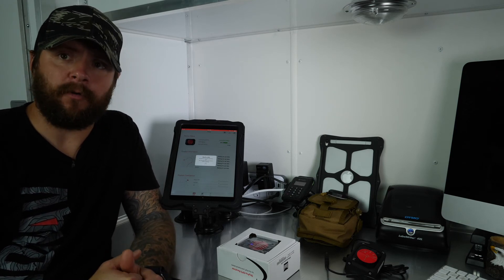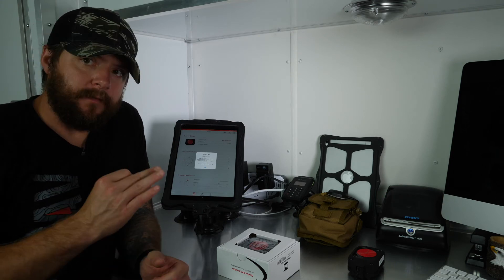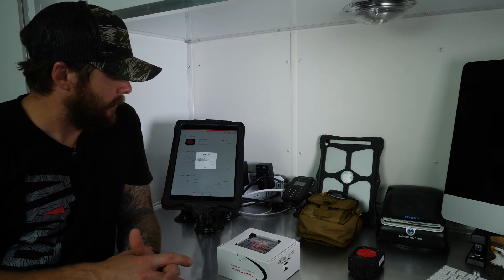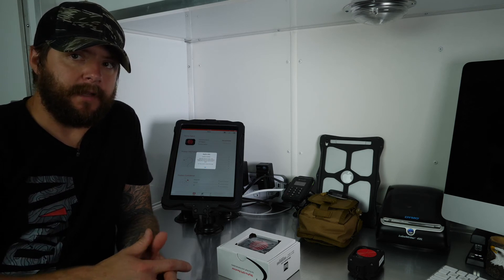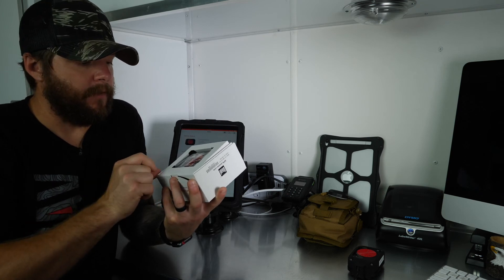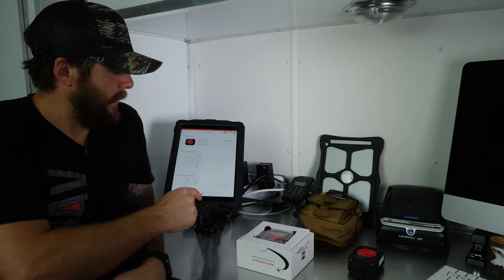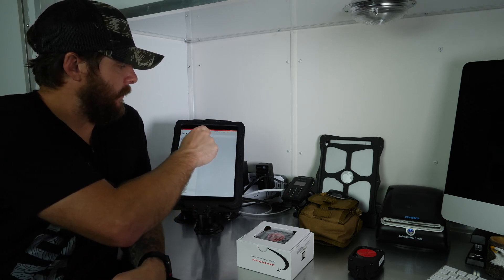The update is wrapping up at 75%. After the update you get a pop-up: 'Update complete — XGPS 160 will disconnect. After forgetting the device in the Bluetooth paired list on the iOS device, pair it again. You may need to reboot this app.' The puck did a firmware update reboot. I'm going to power it back up — I'm back to a flashing green and flashing blue. I'll hit OK on the pop-up, close down the status tool app, go back into settings, and forget the XGPS 160.